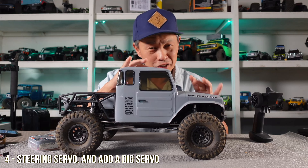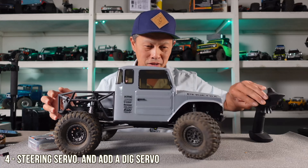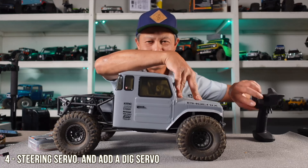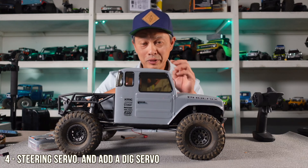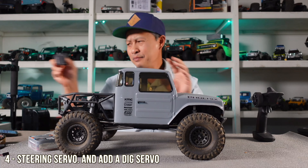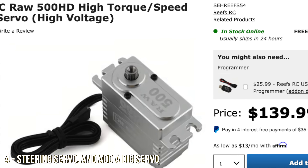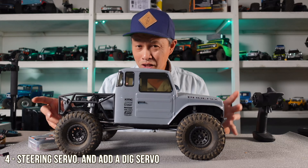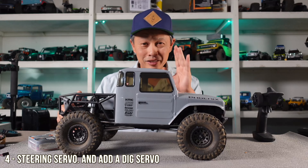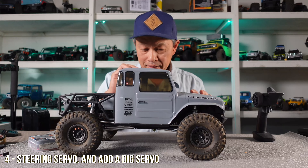The number four upgrade is the servo. It's another compromise — not bad at 200 ounce-inches of torque, but this vehicle can handle a lot more and it's really at its limit. You could definitely do better. Holmes makes a good 500 ounce-inch one, and Reefs also has around a 500-650 ounce-inch option. I don't really prescribe to 1200 ounce-inch servos if you don't really need it — you're just wasting money. An honest 500-600 ounce-inch servo would be good.